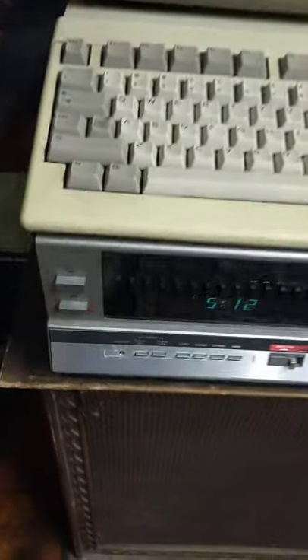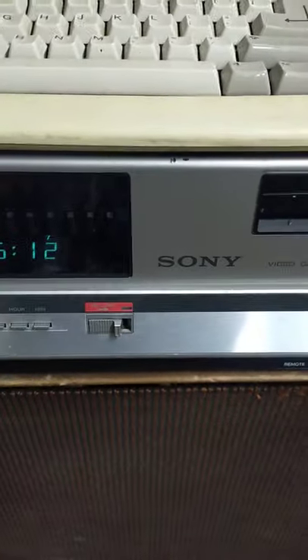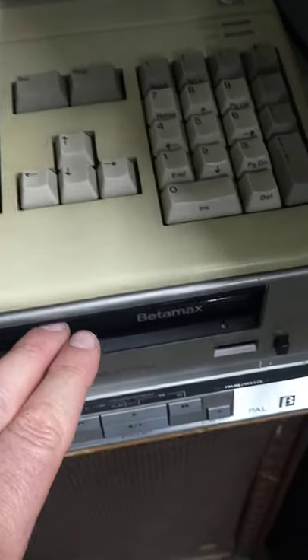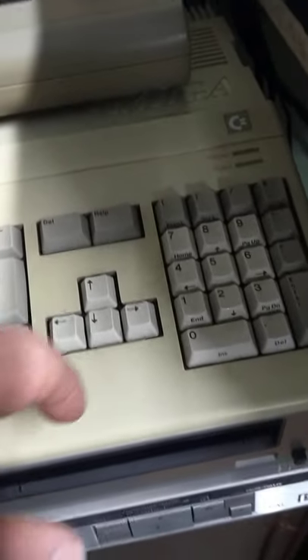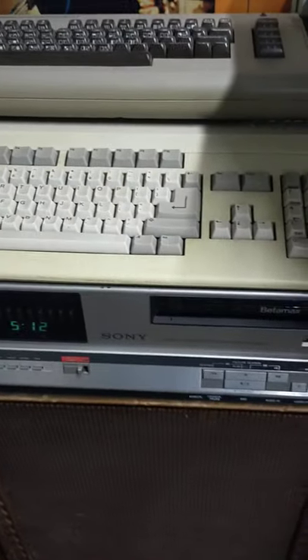Finally, the oldest Betamax machine I have is the Sony SLC6AS. This is the world's first front-loading VCR of any video format. The video heads on this thing are so shot that the picture you see when you put a tape in and run it is green. So I'm just using it as a rewinder. If I put the tape in and it loads, the reel tables won't turn so the tape won't move. All I've got to do is take these off, put the tape in, wait for it to load, then just flick the little plastic reel and it'll turn over — it just doesn't seem to have enough power to do it itself.